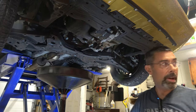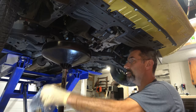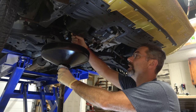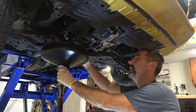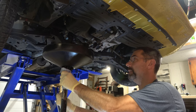There we go. Once you have it started, I'm going to lift mine up just so I don't make a mess — and this thing is somewhat messy regardless. But go ahead and drain that into a bucket. Again, it's only three quarts and a little, so it's not going to be a ton of fluid coming out, but you don't want to create an EPA hazard here.